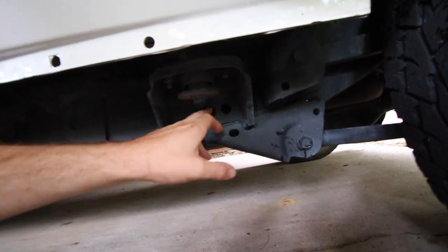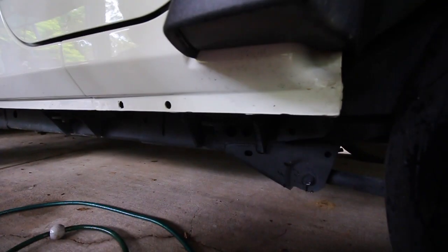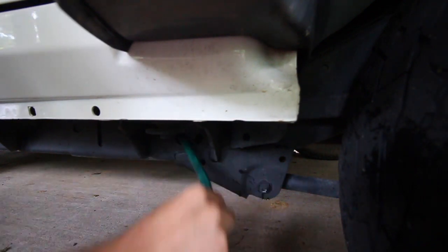Comment below if you guys are giving your Jeeps an enema or if there's some other fancy thing you've done to clean out your Jeep rails. On the Jeep's chassis rail, you've got little holes in the chassis where all the dirt, salt water, and stuff like that can get in. You usually have to pick one — you can do multiple ones if you want — but that length of hose will run the entire length of the chassis.